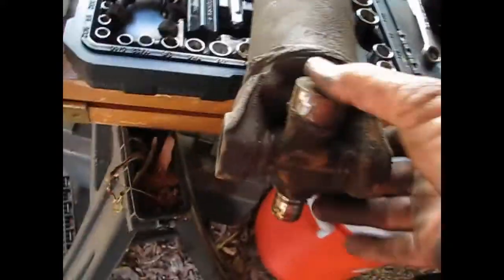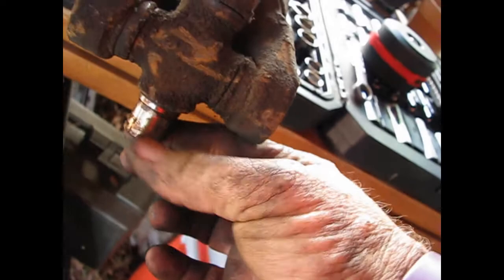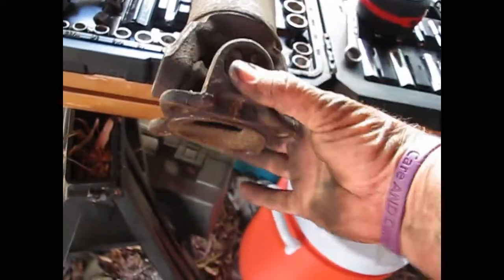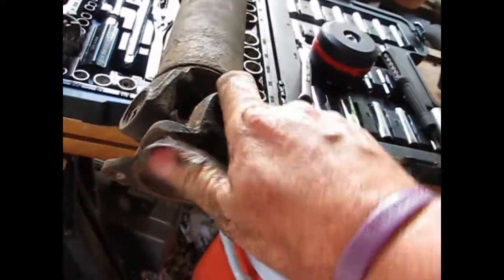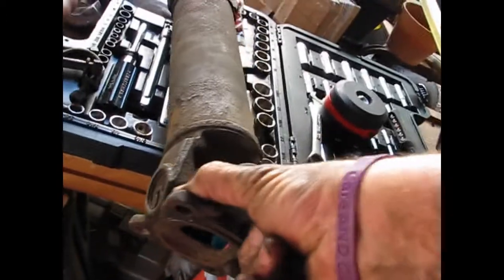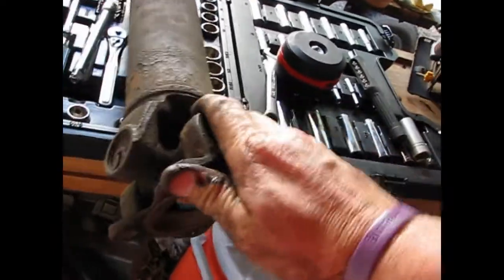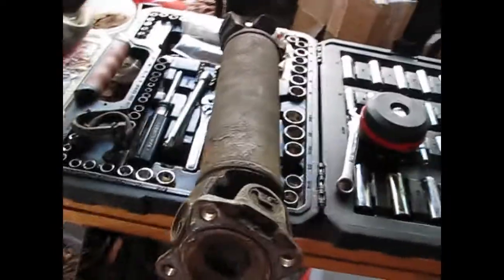On this one, one of the caps fell off in the dirt and most of the needles fell out, but it's got the same problem the other has. It feels good this way, but this cap — the grooves don't feel quite as deep, but they're still pretty bad in there. This side is the same — yeah, very tight. Got to change all four of them.